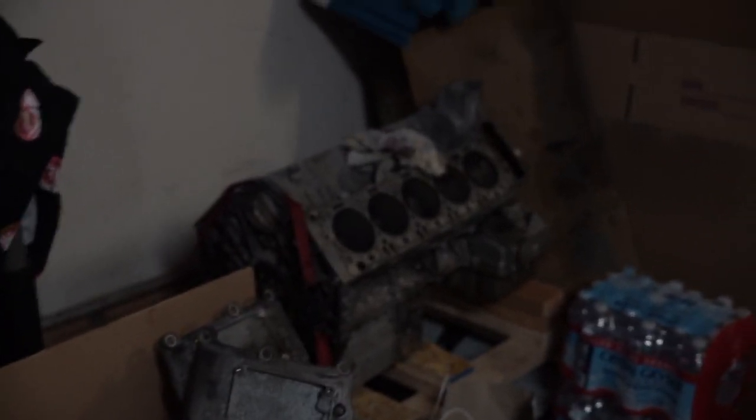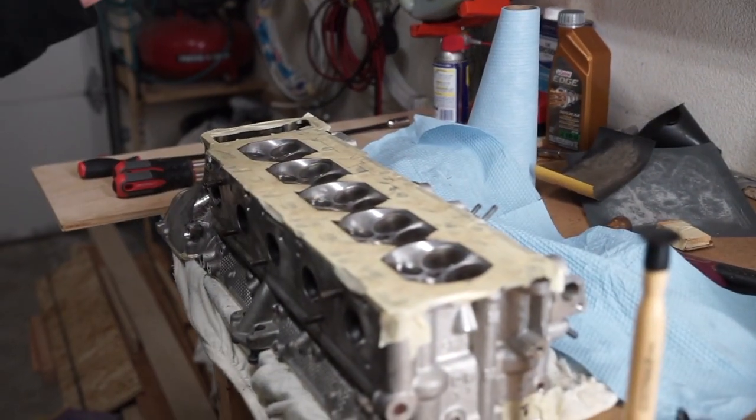I love the motor more than the chassis, so I got this car. This whole build series is going to take a while — we're swapping a V10 E60 manual into this E46 M3. That is the block, it's fully disassembled currently. That's the transmission over there, it's a six speed from an E92 M3. The block currently has 140,000 miles, that's why it's fully disassembled — I'm rebuilding pretty much the entire thing, replacing stuff on the heads, internals, piston rings, so it lasts another 140,000 miles.